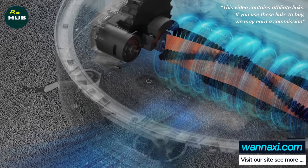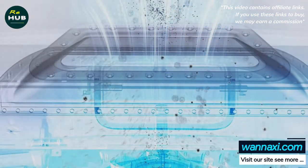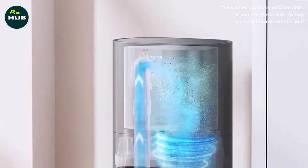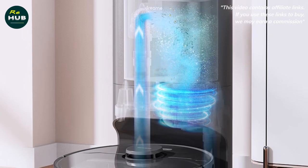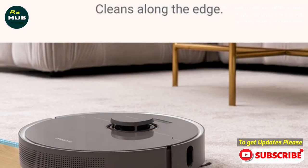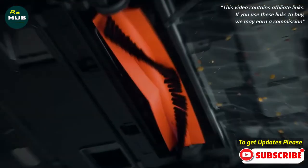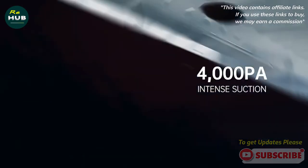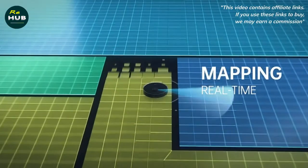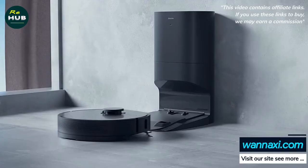Even with one side brush, the robot does an excellent job. Contour cleaning is carried out by turning the right side to the wall and skirting board. The air outlets are located on the back of the chassis. The installed wet cleaning plate is thin and contains 100 ml of water, which is enough for cleaning a medium-sized apartment. A dosing pump inside the module regulates the fluid supply. The napkin is attached with Velcro and after cleaning, you should manually remove the plate and send the napkin to wash and dry.